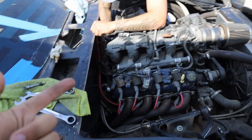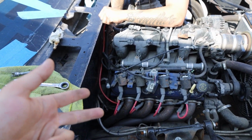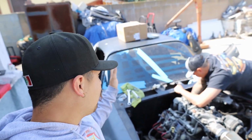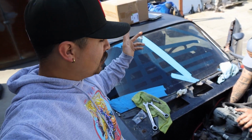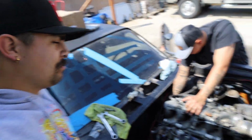So the only things we gotta really change are the oil pressure and the water, because it has new sensors. They don't utilize the same sensors as the other gauges use. So pretty much simple install on this, guys. Even if you didn't have aftermarket gauges before, your original gauges, most of the wiring should all be in the same location as well. It's just gonna be on you to find out what each wire does, and there's diagrams online that show you what your car harness, each color wire is, so it's pretty simple.